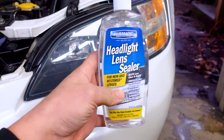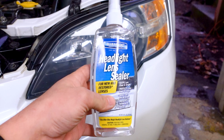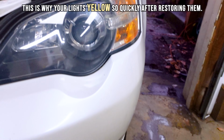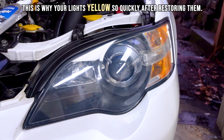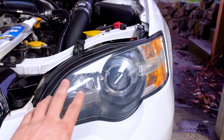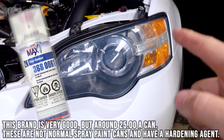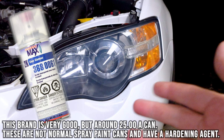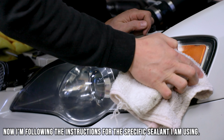I just recommend a UV sealant, so that the sun isn't going to take it off and screw it all up again, because that's normally what will yellow it out in a week or less after you do this. Aside from using sealant, if you wanted, you could use a clear coat. I would recommend using a 2K clear, and I'll put that down in the description as well. The one I recommend if you go the clear coat route.